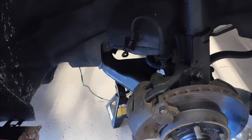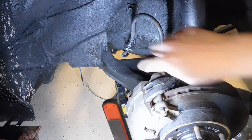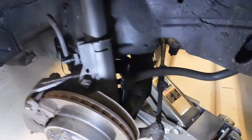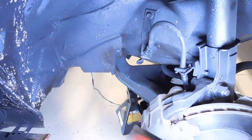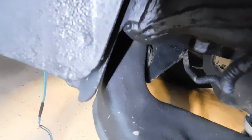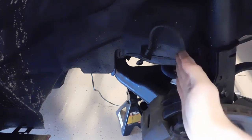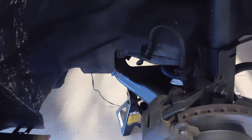One of the last things I want to mention is where the A-arm actually connects to the body — back here where it connects to my K-member. There are a couple of rubber bushings in there. Just to give you a close-up of that: if you have clicking when accelerating or braking, it could be that you have worn bushings on those A-arms, which basically allow the A-arm to slightly move back and forth. If the bushings are worn out, it does allow play and it can cause clicking when putting the vehicle in reverse, placing it in drive, hard accelerating, or decelerating.